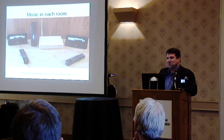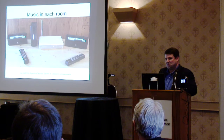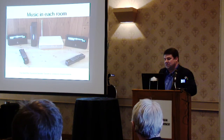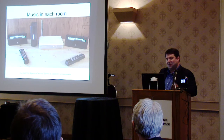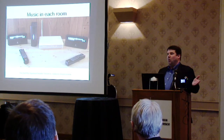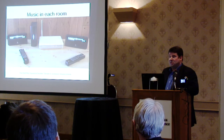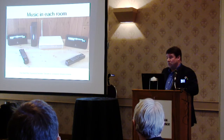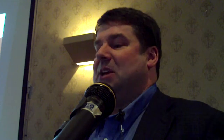Here's an implementation I did for a friend. She has a couple of Logitech Squeezebox music-playing devices — essentially network-attached sound cards with vacuum fluorescent displays showing which song is playing. They need to connect to a server, so I took a wireless router — in this case an Asus — connected a USB hard drive for media storage, and turned that into a music server. Instead of a desktop or laptop on all the time, it just takes a USB hard drive and a wireless router drawing about five watts, giving her synchronized music in different rooms.